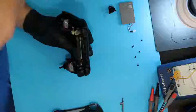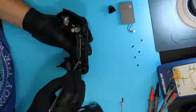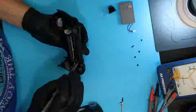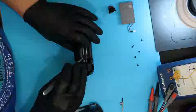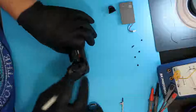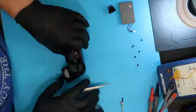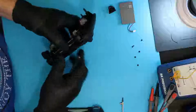Before you try to pull this off, in this particular model, you've also got to press this ribbon cable down. It goes through a little slotted hole in the plastic mount for this motherboard, and that piece that sticks up that you grab a hold of tends to get caught, and you will again rip up that cable if you don't. Make sure that it gets inside the slot before you try to pull it through. And there we go.